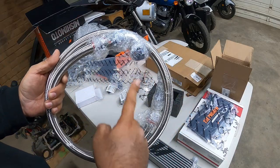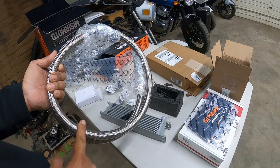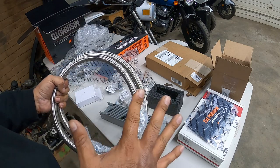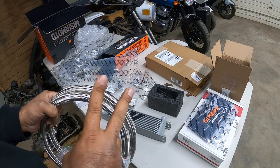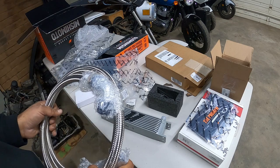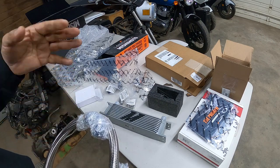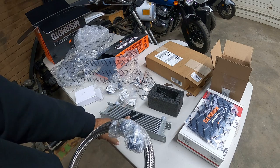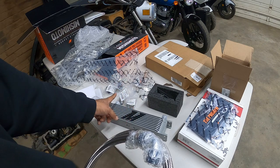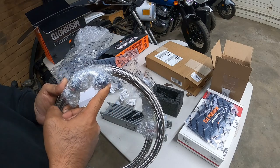These are pretty large lines and they hold a lot of oil inside them. You have to accommodate for all the oil that fills two lines. A 10-row cooler takes about an extra quart of oil; a 16-row will take almost two quarts. So check your oil levels carefully. When you do oil changes, drain the oil, pull the lines off the cooler, and drain it too. Do not leave dirty oil sitting in the cooler — you'll just cycle dirty oil back through your engine.